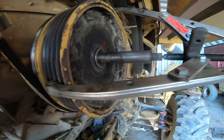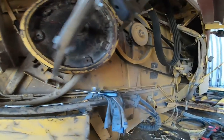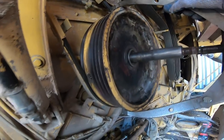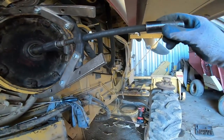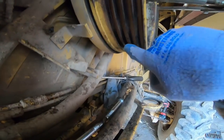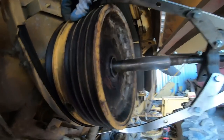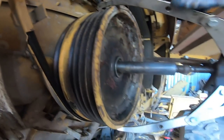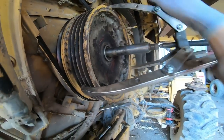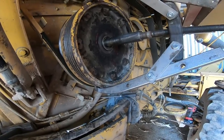We're going to put bearings in here because who knows how hot it was and how much the grease melted. I'm pretty sure it's coming off — if we look really close right in there, you can see where the grease has moved a little bit on that ring. This is all held on by the nut out here, and it pulls into everything. I hope we don't need bearings going through the wall of the machine, but since the clutch is right here contributing so much heat and it was smoking and smoldering good — you can still smell it.